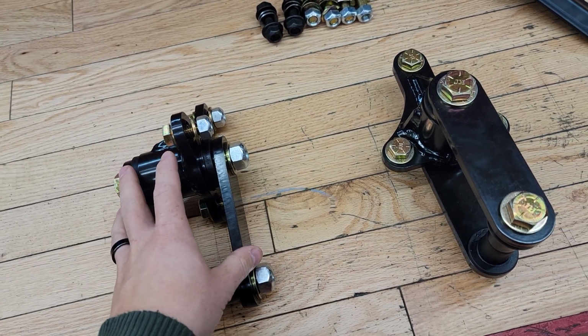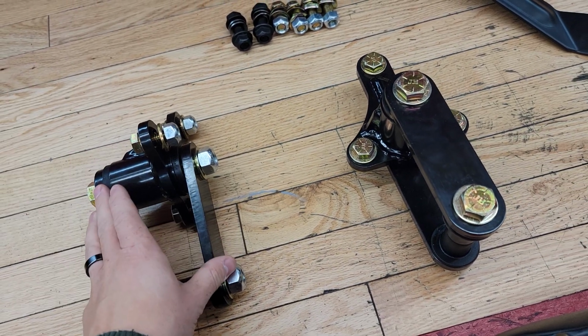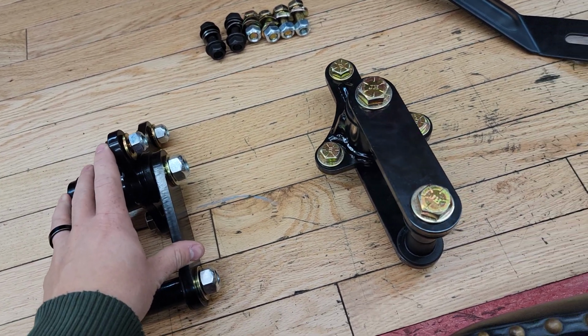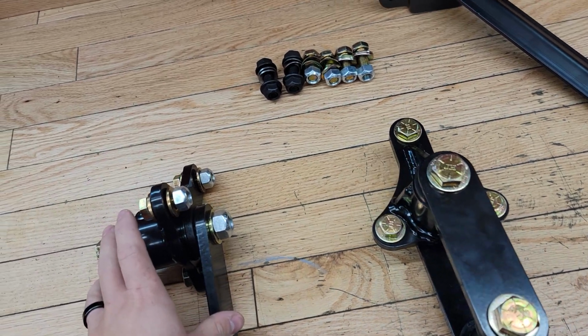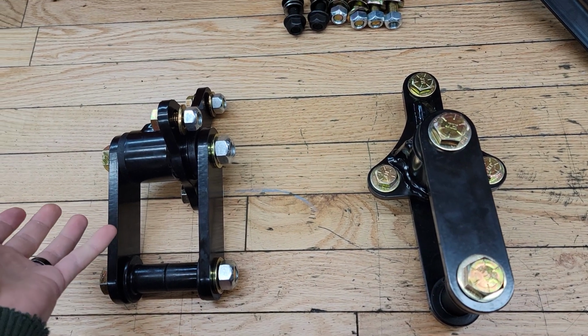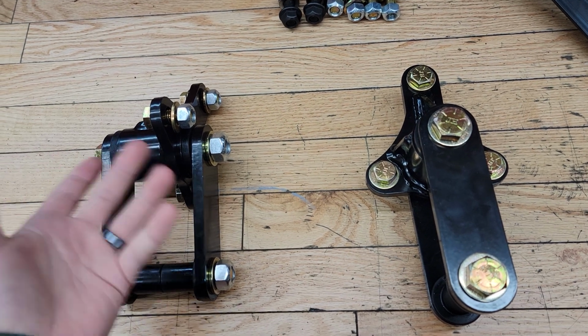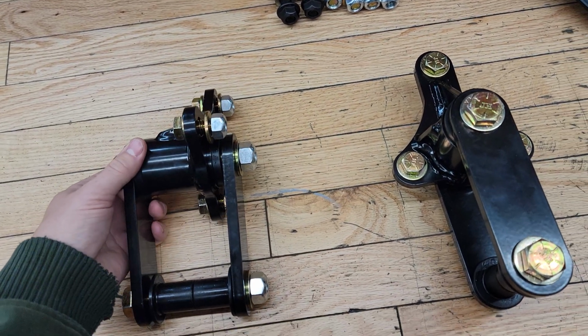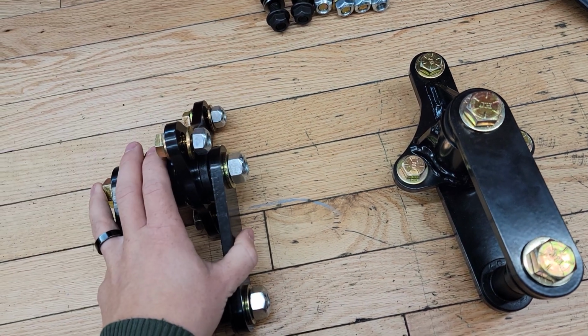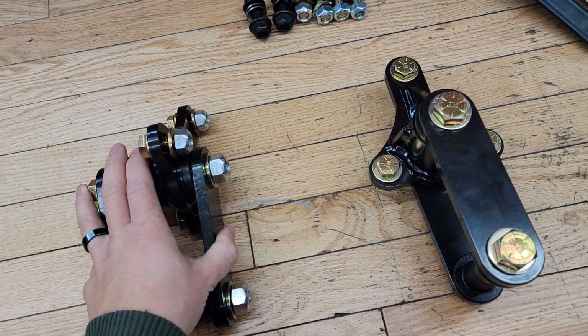I just installed the front spring hanger, so this is the next step to improve the ride quality a little bit, hopefully. We don't know what sort of shape those bushings are in the back. The reason I'm replacing them is because they're 30 years old, and I want a little bit better of a shackle. These are nice and heavy duty, a little bit heavier duty than the stock ones that are on there.